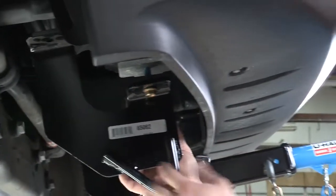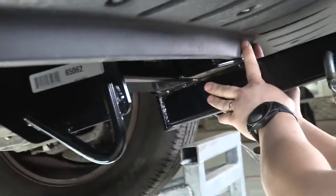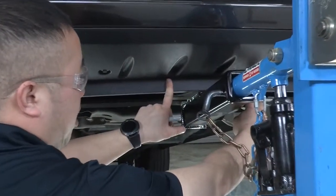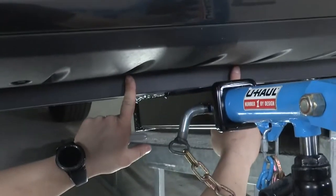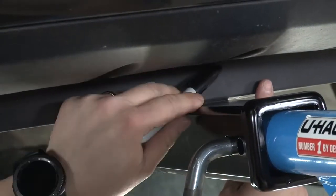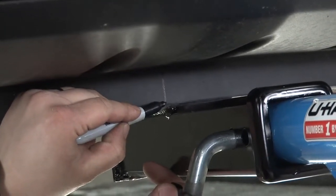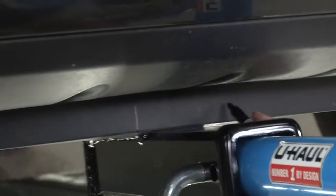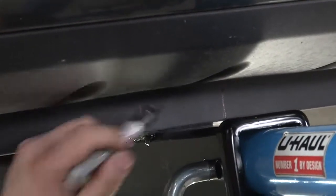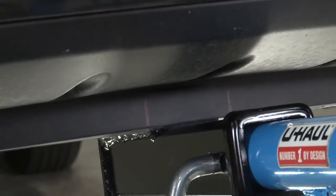Now that we have just the two bolts holding it into place so it does not slide back and forth, you can see how much we'll need to trim on the front bumper here so we can get the hitch to go up into position. The instructions call for eight inches of trimming, but for this particular vehicle we don't need that much trim. We're going to be trimming just the width of the receiver tube, and then we're going to be doing an inch and a half up to this bottom lip here. That's the only piece that will be taken off for it to fit. So we'll make a straight up and down line here, one on the opposite side as well, then just right across the top. Then you can pull your hitch down out of the way and start your trimming.